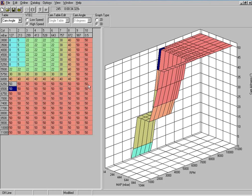And if you keep on retarding the cam to 0, you're going to lose power, because when you go back onto full throttle, you're not going to be at 50, you're going to be going 10, 20, 30, 40, 50. And in a supercharged vehicle, you need to keep the cam at full advance. If the cam is retarded, you'll get a boost spike, and that boost spike will actually cause you to lose power.